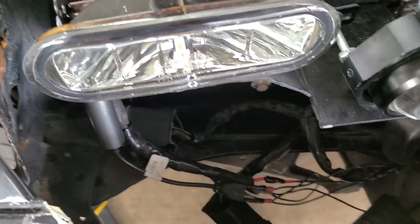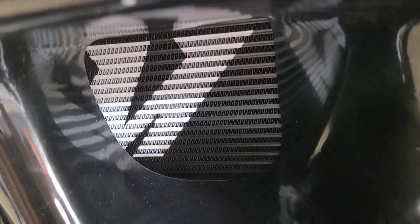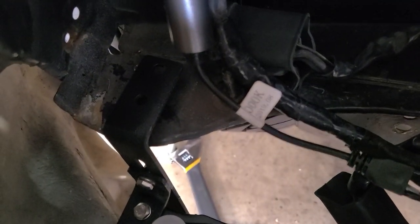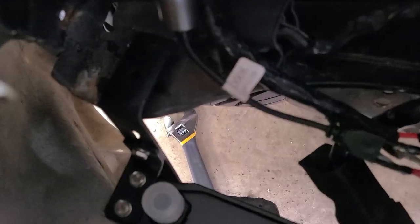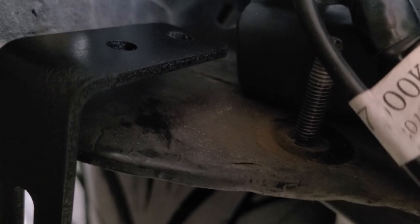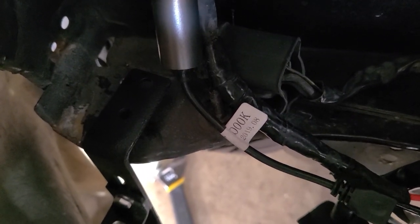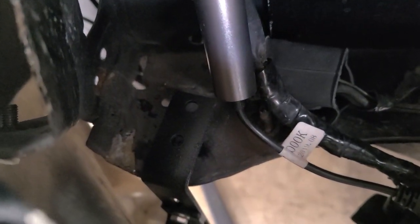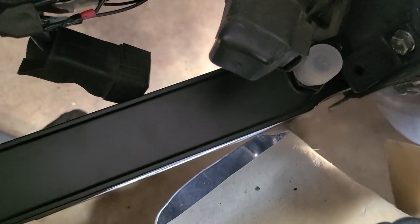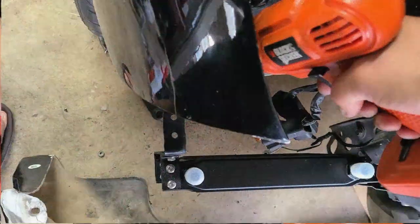If I put the bumper where it's supposed to be, this is how it will look in the front, but check the bracket. It lifts the bracket up like an inch. So definitely we'll have to get spacers. I'm gonna mark the holes there. I thought I was gonna use only one hole, and I'm gonna end up using both. It kind of touches or barely touches the oil cooler, which is good. You won't scratch the paint.